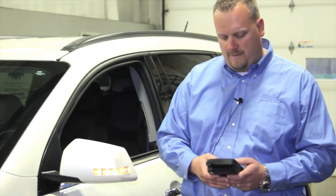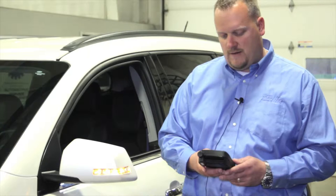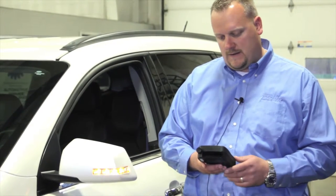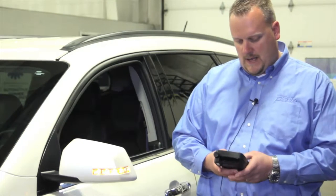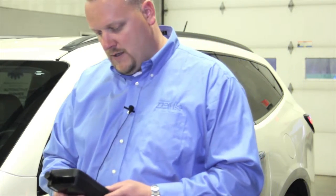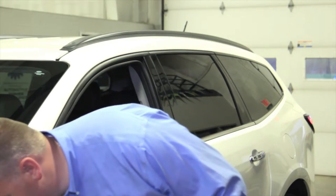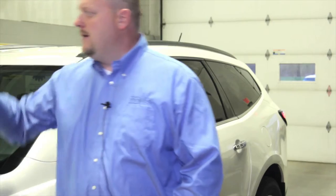So I know I'm going to start here with the left front tire. I'll enter in the vehicle — built as a Chevy Traverse — select the year. This is an OE design sensor and I want to read the sensors. Now I am going to test the sensors. This one works okay.